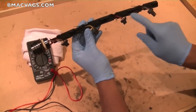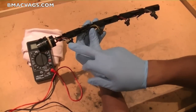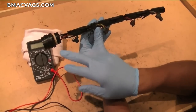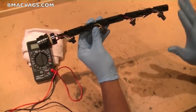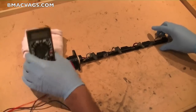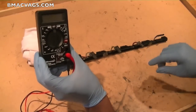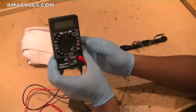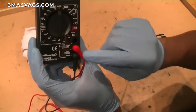You've got one main feed down the spine and then individual ones — the ECU will say gray one go off, yellow one go off, red one go off, and so on. So get yourself a basic multimeter. The first thing you want to check is continuity — it's this setting here.